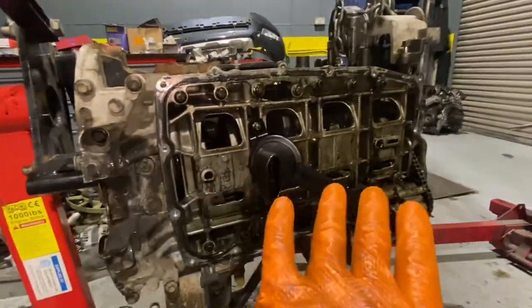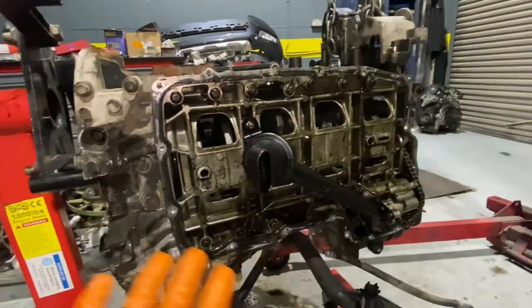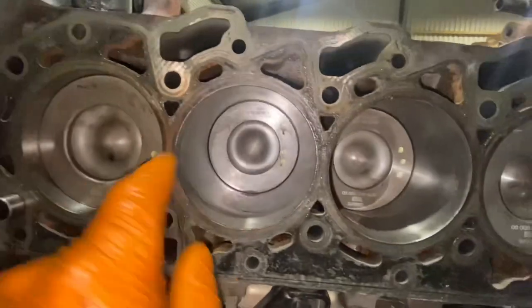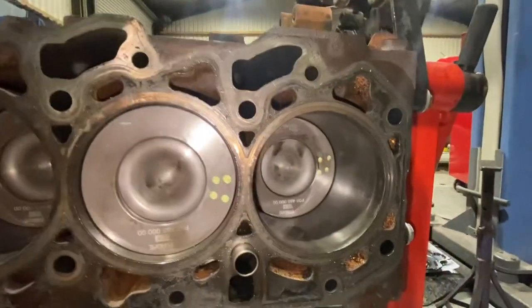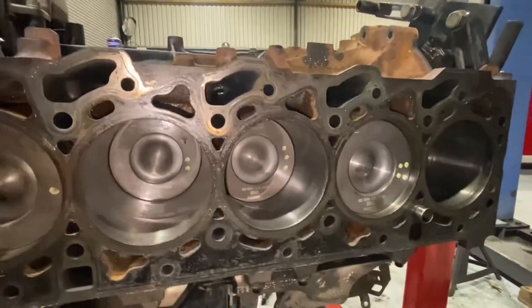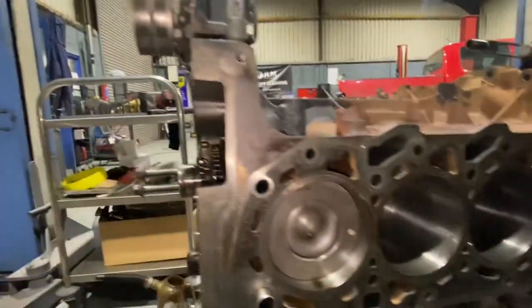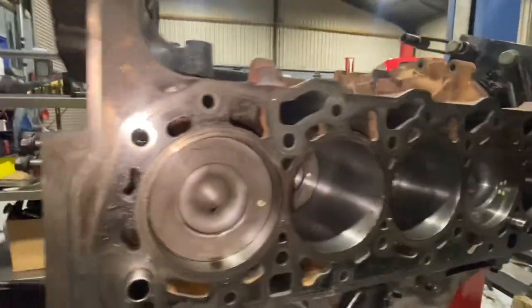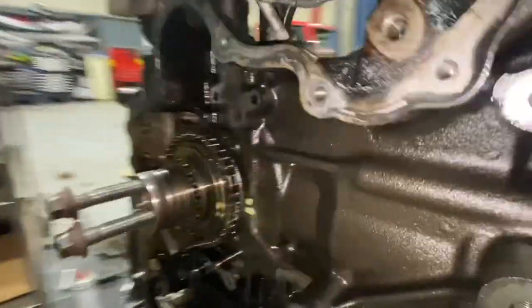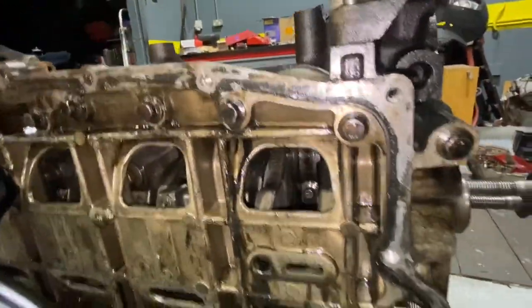Okay, guys, I have fitted in my pistons, big end bearings gone in there. My, what do I call that thing? Crank box, I don't know, the lower part of the actual engine section that I've been fitting on. My pistons, all my new pistons are popped into place, numbered again and all pointing forward and doing their job. Engine is on its side and turning around. It turns relatively easy, I wouldn't say relatively easy, but no, I'm not going to do it with one hand anyway without something to drive it. I was only sticking a screwdriver in here, but it spins away the finest. Cylinders and all that are oiled up and big end bearings after getting a little knob of oil in there, they're torqued, all going back together.